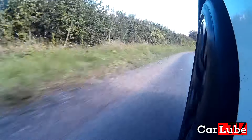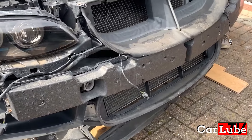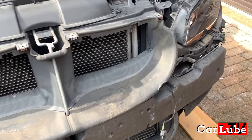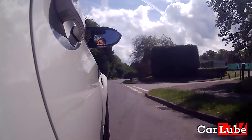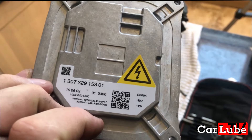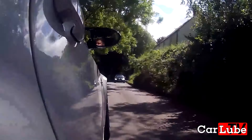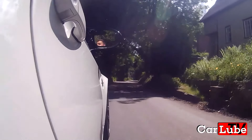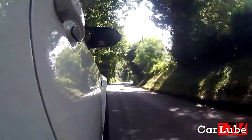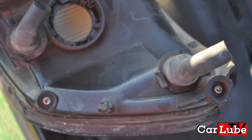As long as you deal with this issue quickly, it needn't be a big deal. I had this problem in the past when my Xenon headlights wouldn't ignite. I was forced to remove the front bumper to get access to remove the offending headlight. The ballast was completely sodden with water — this was a complete pain in the backside. After purchasing a second-hand ballast and finding it to be faulty also, I was lucky on this occasion as I was able to dry it out with a hairdryer and avoid the huge cost of a new one. While the headlight unit was off the car, I did take the liberty of checking there was sufficient sealant around the lens and making sure the drain plugs were clear from any debris, thus preventing future water incursion.